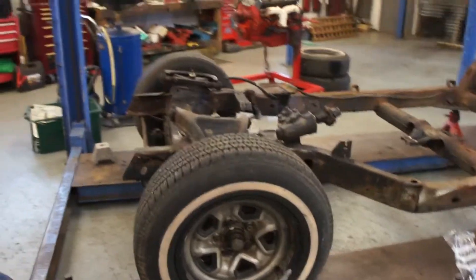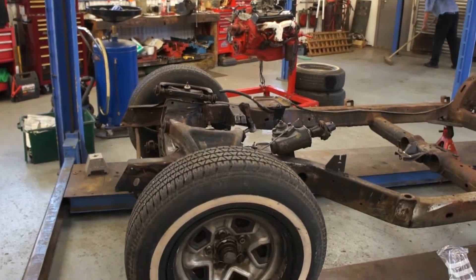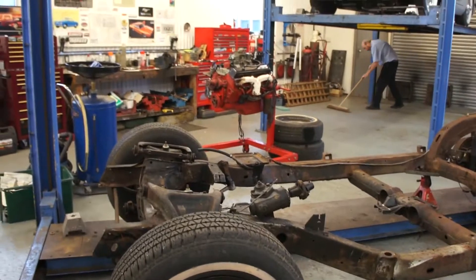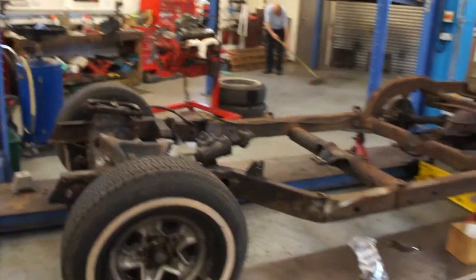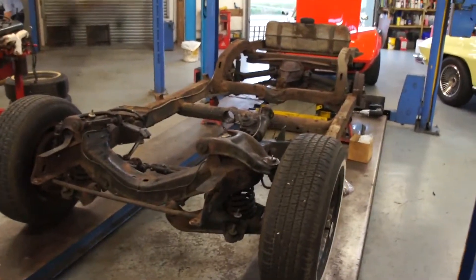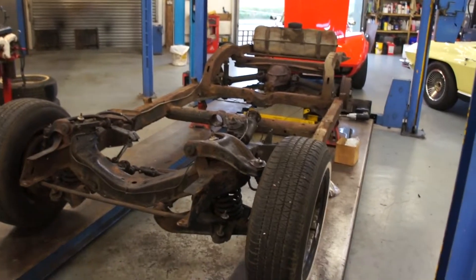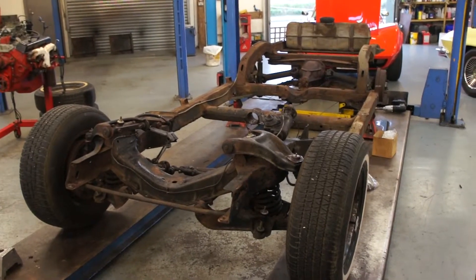Hi John. You can see we've had a fairly big push — we got the engine and transmission out yesterday, which is over there on a stand. We've separated the transmission, clutch, and flywheel. I had a quick look at the clutch and it seems okay, but you do wonder whether it's prudent to just put another one in while it's all apart. The thrust bearing was very, very noisy, so that needs replacing at the very least.